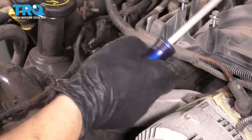I have a head bolt ready so that when it does drop in, I can just put that head bolt in. Oh, lines up on the front, lines up on the back. Perfect. That's in. I'm going to put in this middle upper one right here and thread it on a few threads so that it can just be held here and it doesn't risk falling. Obviously I'm not tightening this yet, but there we go. Now if it wants to fall off, well, it can't.